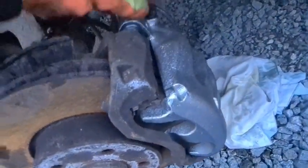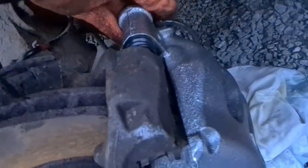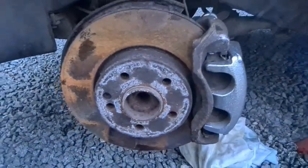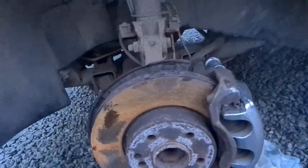What you do now is put that pipe on the inside of that bleed nipple valve. Pop it on. Hold it in one place, and then pop it in the back here. Oh, they were stuck. You can see where they're stuck on. They were stuck, that's why. That's done, really, then. Okay. Right, we're going to do the other side.